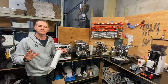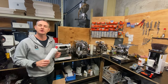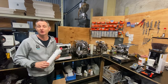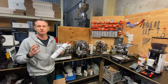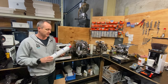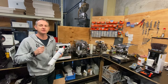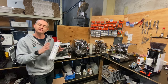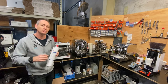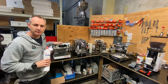The main issue we have with all coffee machines is water. It's funny that they use water all the time, but it's the one thing that will always kill a coffee machine. Having a really good filter is key to fixing that. We use 3M filters — depending on where you are, every filter will do a different job, so the best thing is to do a water test and then work out what filter is going to address the issues that your local water has.